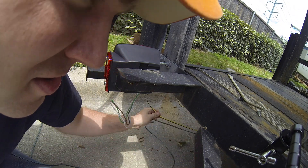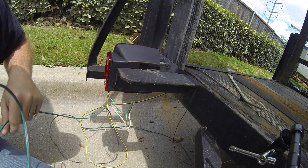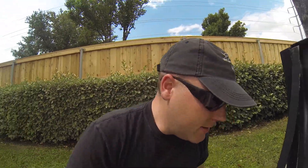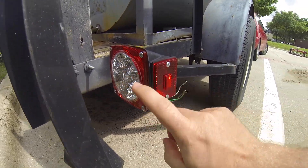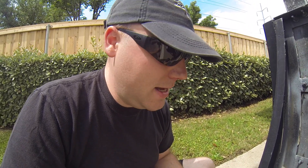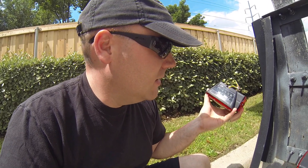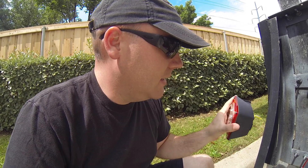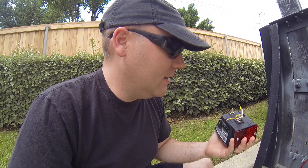Now that we've got this all to length, I'm just going to pull the slack back to here. We're on the right side of the vehicle — the right side gets brown and green. Yellow and brown is for the other side. I made a pretty serious mistake when I started working on this trailer and ordered the taillights. I ordered two taillights that have the taillight and the turn signal on them, and I was just going to put one on one side and flip the other one upside down. But they're not reversible, because the one that goes on the other side has another light on the bottom for lighting up the license plate. If you don't light up your license plate, it's not legal. So I had to return that one and buy the right one, and it just came today.